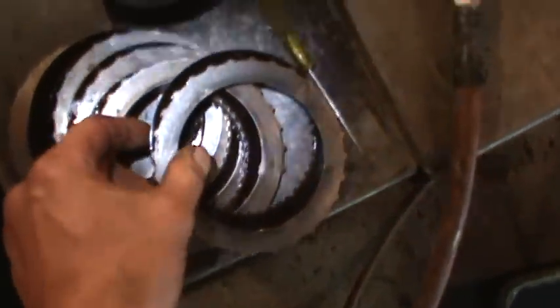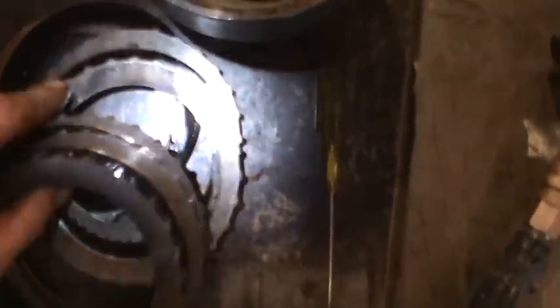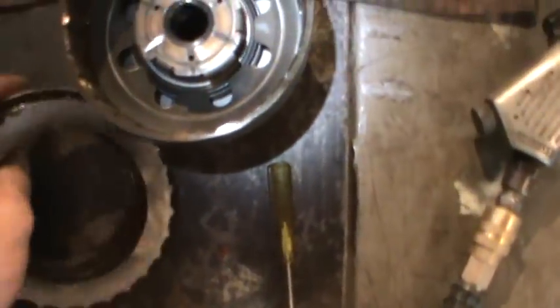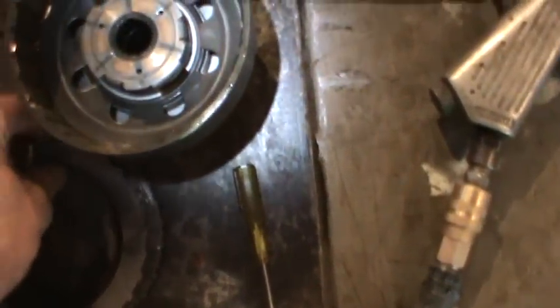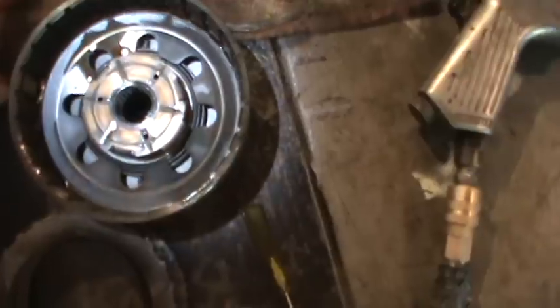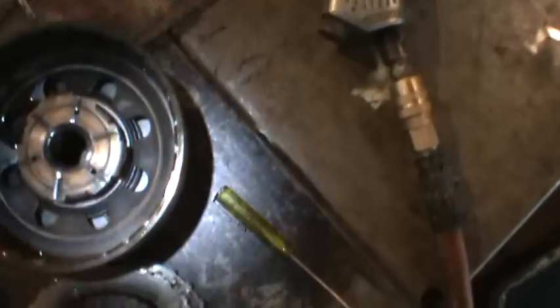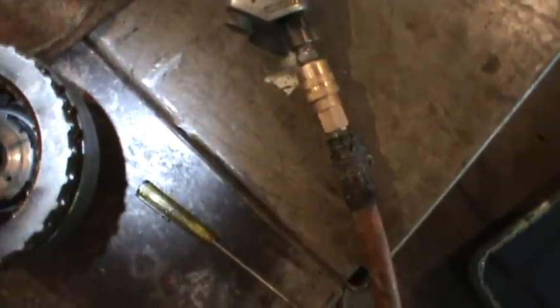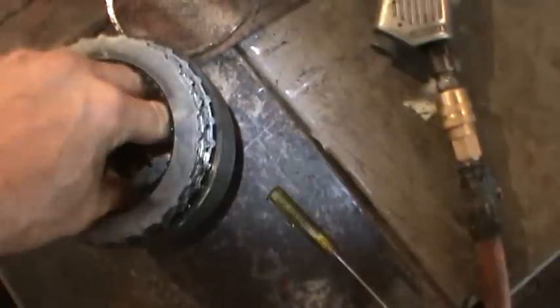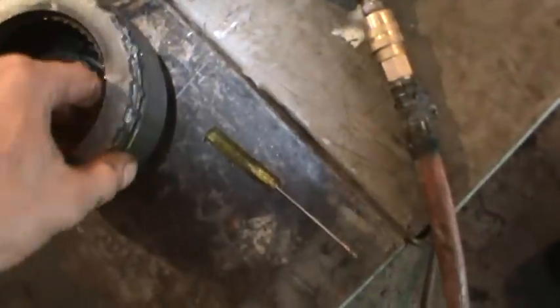I cut into the other one to see what we had, and this clutch pack looks pretty good — I don't really see any wear at all. I was under the understanding that the clutch pack has a lot of pressure on it and you'd have to clamp and compress it to get the retaining ring off, but it didn't. They just came out, and there's probably about 20 thou play in the clutch pack.